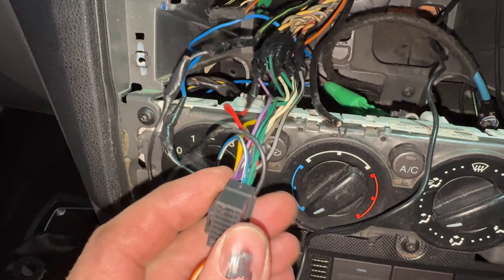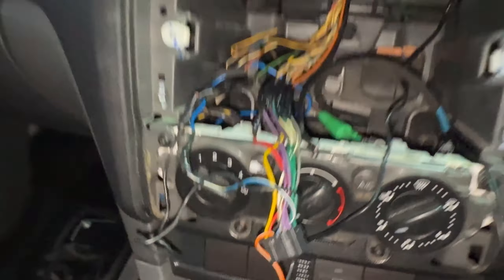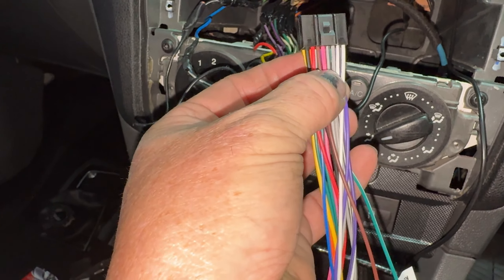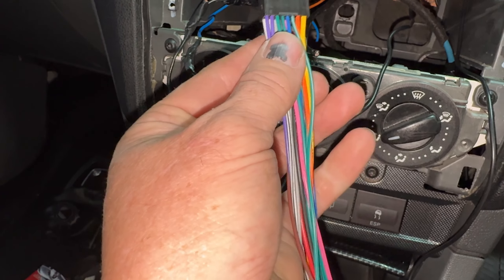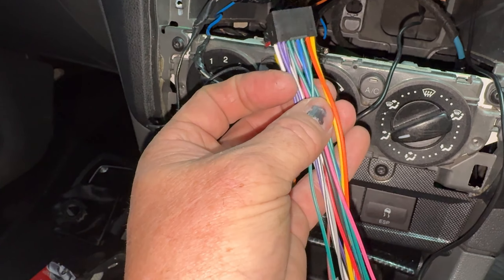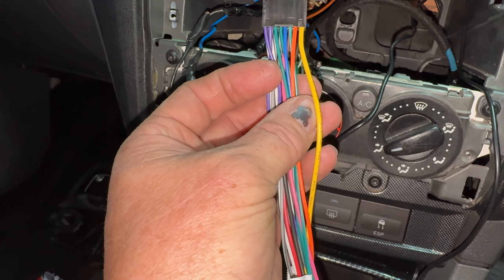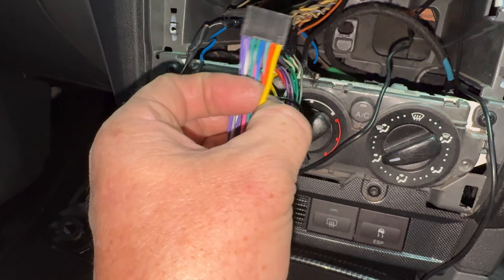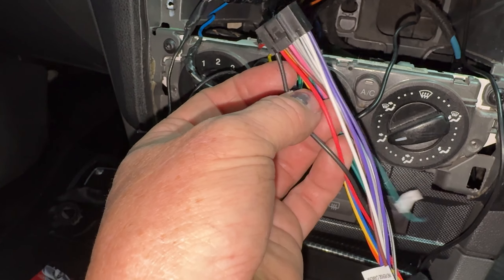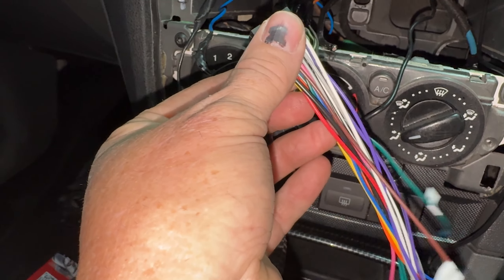Next job is to amalgamate these two harnesses together and connect up the new harness with better connections, and connect the steering wheel controls to the new system. On the head unit side, you can see we've got the white/ash and purple/green pairs — all the speakers. Blue is always the power amp. Green on this head unit is Key 2, part of your steering wheel controls. Orange would be the dimming lights for the parkers. Yellow will be power or accessories, black is the negative, red is the opposite power or accessories — thinner wire usually means accessories because the load goes through the battery circuit. This brown wire is for the reverse camera.